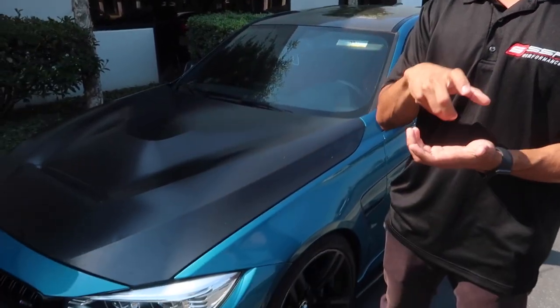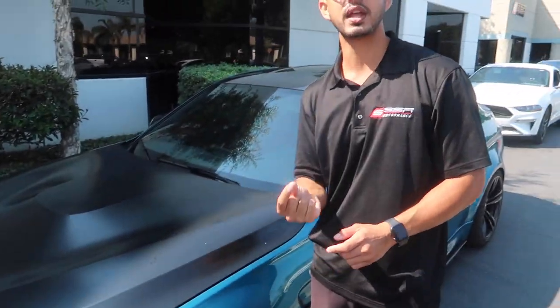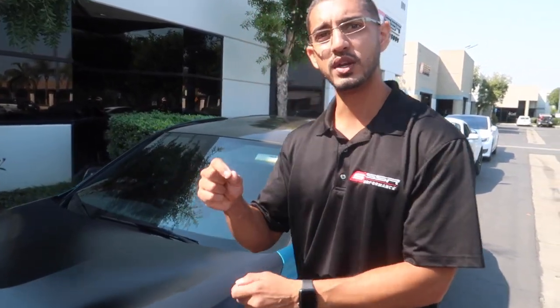And even after the color eye camera does its magic, like I said, the camera itself is $7,000 and the system itself is over $100,000, but then my master painter, who's been painting for 20 years, will go in and say, nope, it's a little off. We need to add this toner. We need to add this kind of metallic, be a little bit more coarse, a little bit more fine in the metallic, and then another final card is painted.